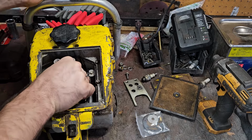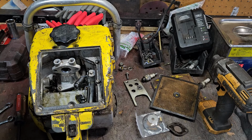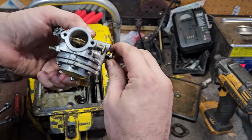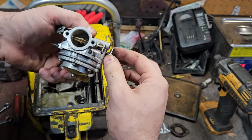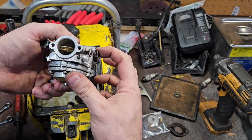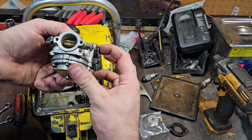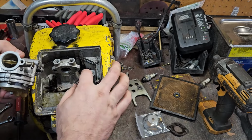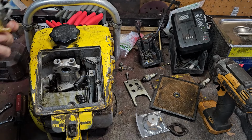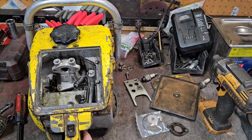We're going to be replacing that with Tygon. Gasket. There we go. And it's a baby carb. See? It reverts to wide open throttle automatically, and then your lever for your throttle closes it, and then as you just let it, you're letting it relieve pressure and shut. But if that were to slip past it, this thing would go wide open throttle on you. So, kind of a danger moment there with that.